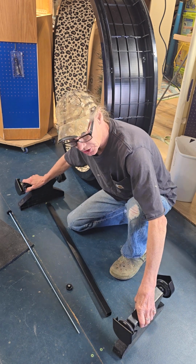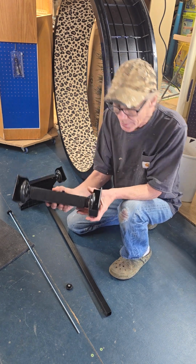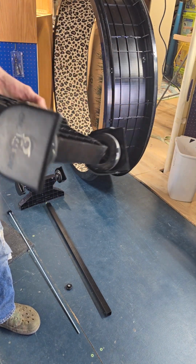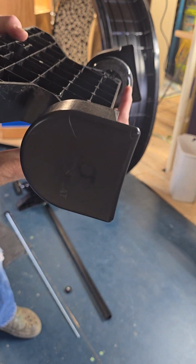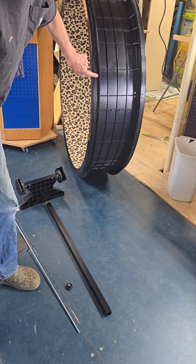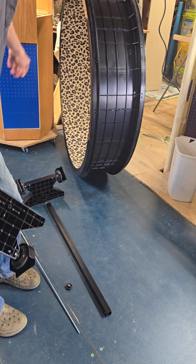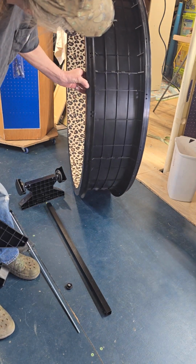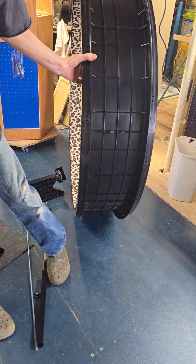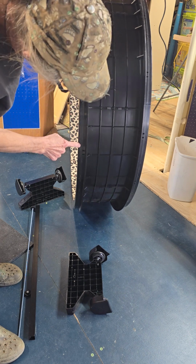It's not the wheels. This is a 6th generation, and they did convert to the inline wheels. Now, when you examine this wheel, and you'll see it in my other videos, you can see the inside of this wheel. See how white that is and marred up? The unit won't stay on track. The track is that wide, one knuckle for an inline wheel, in theory. The thump, thump, thump are the seams, not so much the clip spots. And you can see, because I haven't even wiped it down, I live in the desert, so of course we're going to have dust, which is a great indicator for this video. So you can see the track line.